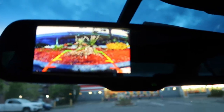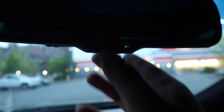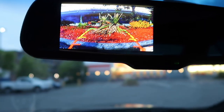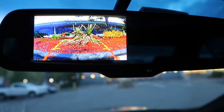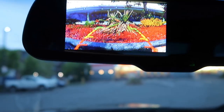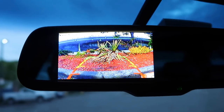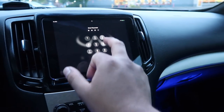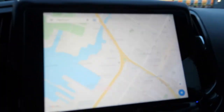Put it in reverse again — little light turns on and there's your backup camera right there. It also has a power button in case you don't want it on even when in reverse. You can wire it differently so it's always on and you just press the button, but that would keep the backup camera running all the time and cut down the camera's lifespan. I wired mine just for reverse.